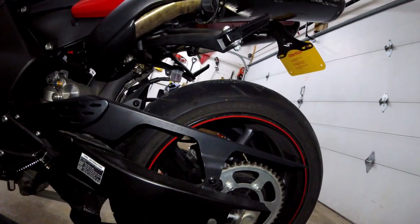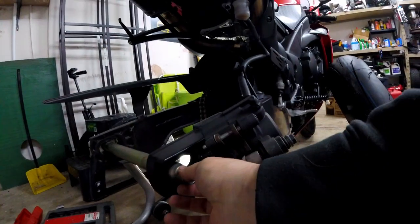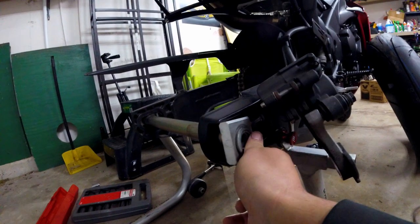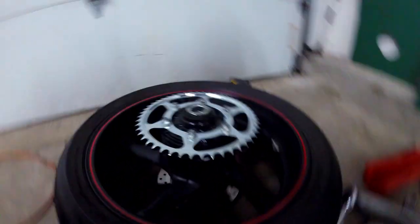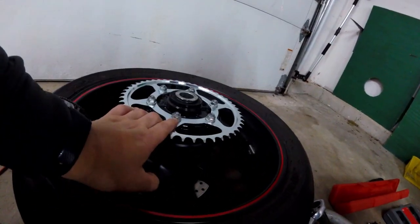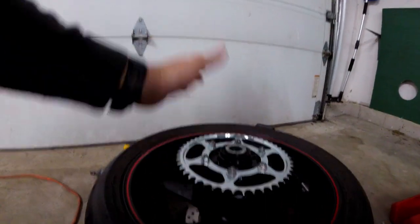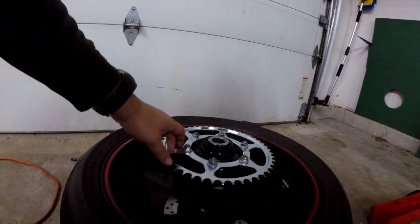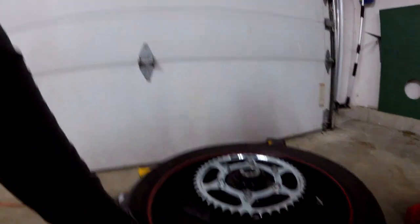What we've done is feed the chain into the front sprocket, then removed the 32-millimeter nut to take off the wheel and slide off the brake caliper. This is a perfect time to check your brake pad material — and it looks like there's plenty left. We installed the new sprocket. The spec I've seen is 72 foot-pounds of torque, but a lot of people torque it to 30 because at 70 it strips the bolt. I'm going to go with the online recommendation rather than the OEM spec this time to avoid stripping the bolt.